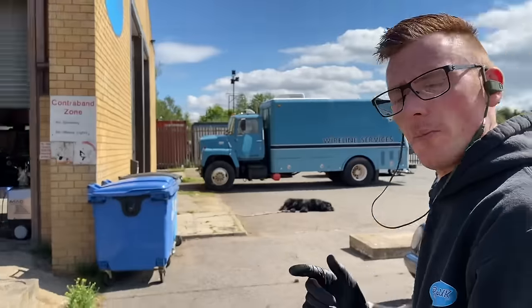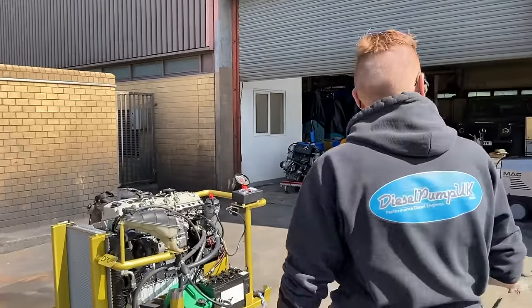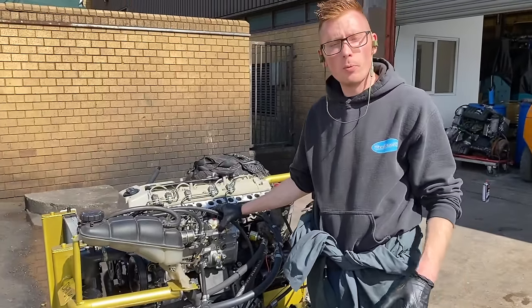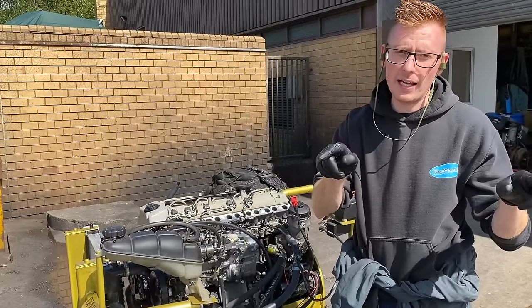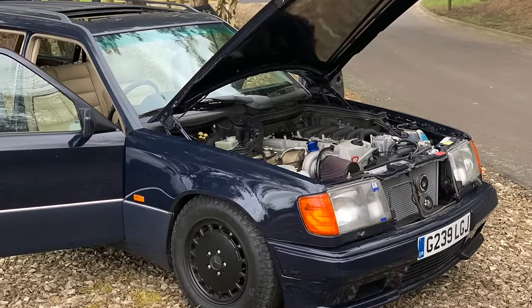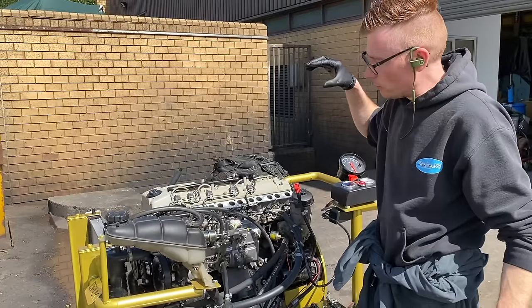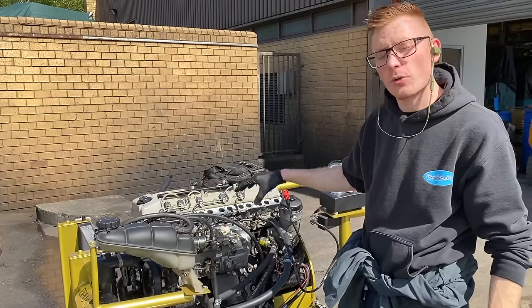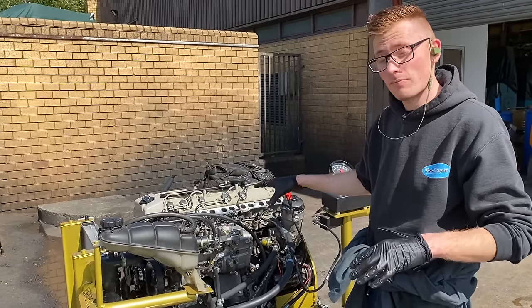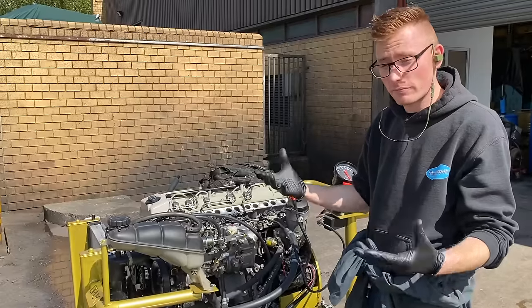One of the things that makes it really special is that you can take a mechanical injector pump off the older series of Mercedes — the ones with the squarer headlights, the W124 models for example — and you can build that up with big elements and fit it onto that special, powerful, strong engine.